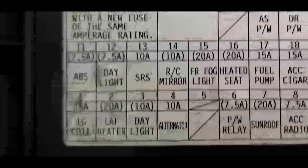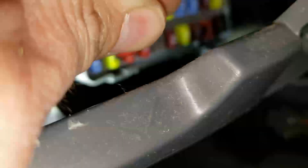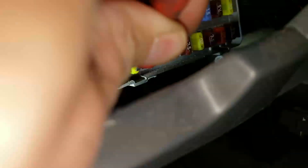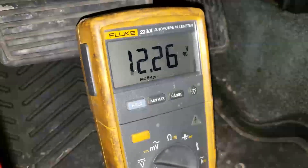So I located fuse number 2, and I connected a multimeter lead to the dash ground. We're looking for fuse number 2. We take our lead and test it there with the key on, engine off — on that side of the fuse, and then also on this side of the fuse. A good fuse will have the same voltage on both sides.